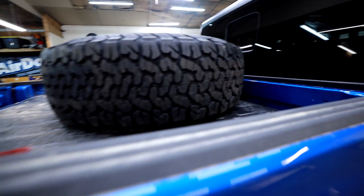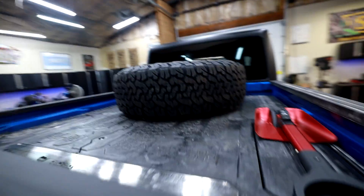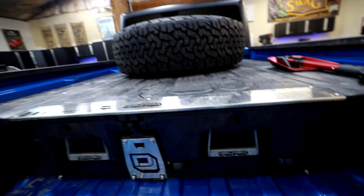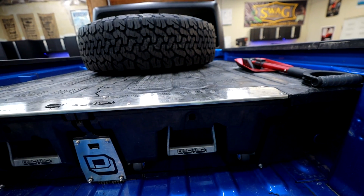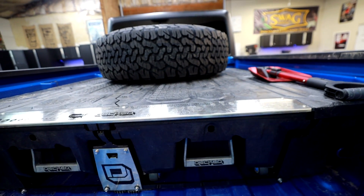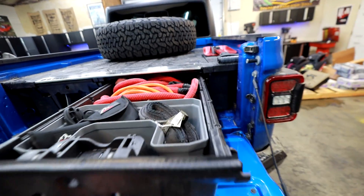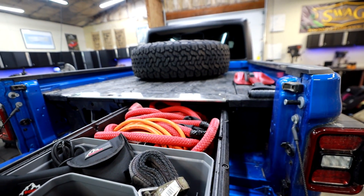I don't love plan A, so it's time to deploy plan B. Once I started to drill into this plastic and realized how soft it is, I realized I need some fat fender washers underneath there and we're just going to put bolts all the way through. Even though it's going to be kind of a chore because I've got to get my son under there, it's definitely the best way to do this. Come on — whose kid wouldn't want to crawl underneath a deck system like this? He was crawling underneath there anyway. So I'm going to go grab him and we're going to do this the right way.